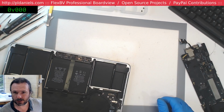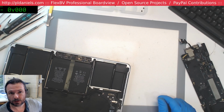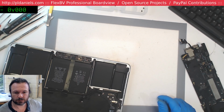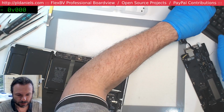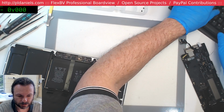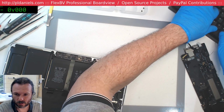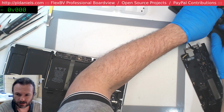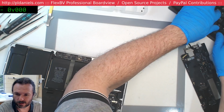I'm going to leave a message for the person who sent me these horrible boards. Dead PCH on A1502. I can supply a replacement 3115 board though. Donor board has damaged screen connector, and God only knows what else.